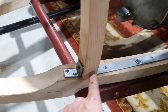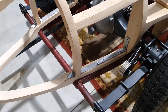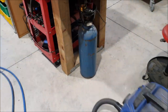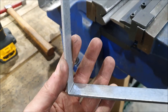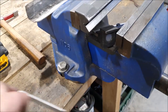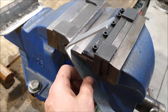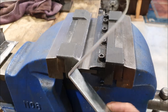This was the only place I thought it might be weak, and I can't bolt through because of the curve here. So this will bolt all the way through here and then there'll be two wood screws that go into that to make it all nice and solid. It took way less time to explain those than it took to make them - that basically took all day. That's an awful lot of bending, grinding, welding and working out angles. To bend the steel - it's just three-millimetre steel, galvanised - I had to get the galvanising off where I welded it.